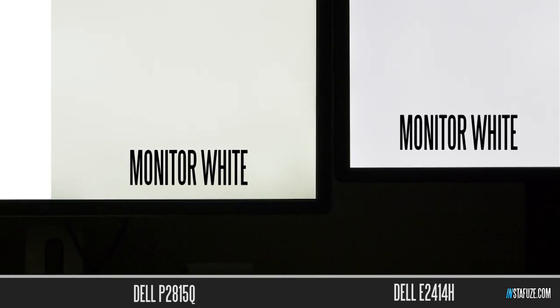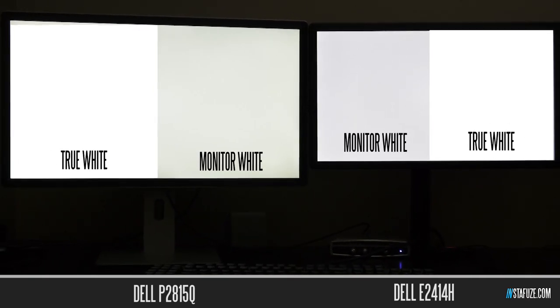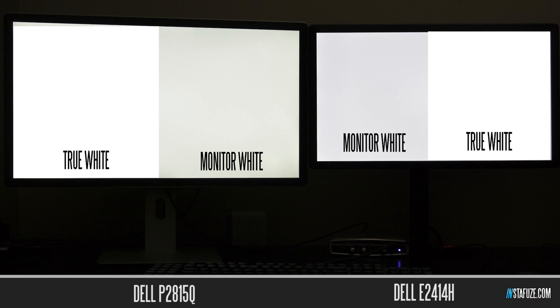Coming back to our comparison, the backlight bleeding is fairly even and consistent relative to the 24-inch. There are some hotspots here and there, but it's typical of what you'd find on a consumer-grade panel. Here's probably one of the biggest disadvantages straight out of the box: the color balance of the pure white the monitor can replicate. Both monitors are on the exact same standard picture mode setting, and the camera has been custom white-balanced for the most representative whites. The 24-inch is way better at representing a truer white, and there's a huge shift toward a reddish-green tone on the 28-inch UHD monitor.